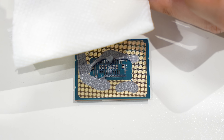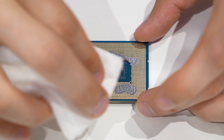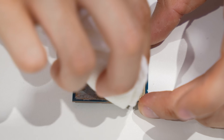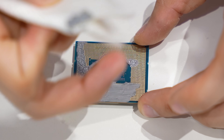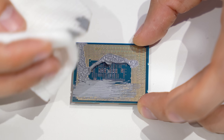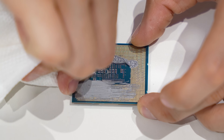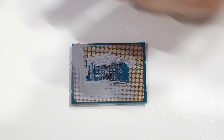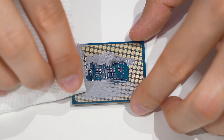For the CPU side of things, I'm just going to get a paper towel damp with IPA and scrub carefully along the pads since we don't have to mind any pins here. It looks like I've made things worse, but we really need to remove a lot of this material from the underside of the chip. That's why I'm trying to scrub it away versus smear it.